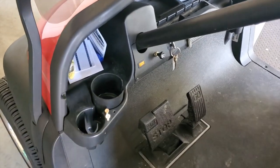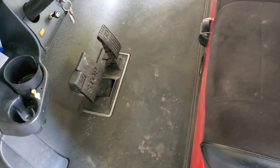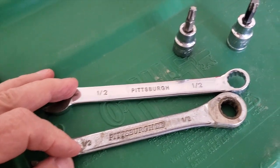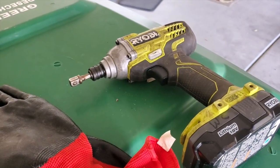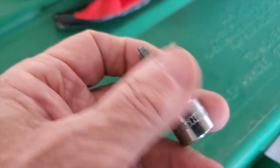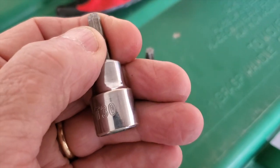What has to be done: I need to pull the floor up and take this pedal group two out. To do those things, here's what I'm going to need: two half-inch wrenches, a ratchet, or in this case a battery-operated drill, and two torx bits — a T30 and a T40.